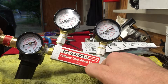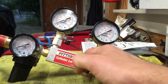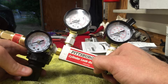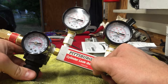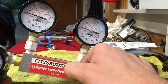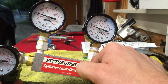I'm going to plug the end of the leak down tester with my finger so it's sealed and slowly add pressure. Opening that valve up, pressure starts coming up — I'll get it to about 20 psi for demonstration purposes. Now you can see both the pressure available gauge and the leak down gauge are reading the same, which makes sense because the system is closed and there's no leakage.